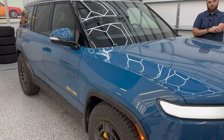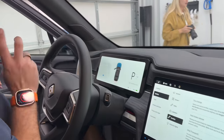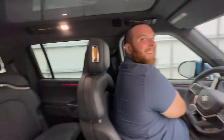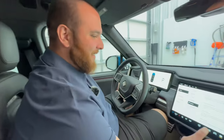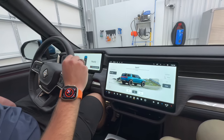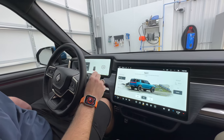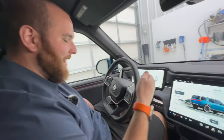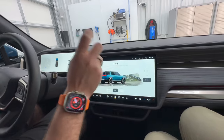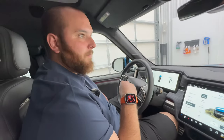Before washing, make sure all your windows are up — that back window was cracked. We're going to put it in neutral and raise it to the highest suspension setting, which is really important for cleaning wheel wells. You'll come into the vehicle, put it in neutral — hold the shifter to the middle setting just like a Tesla — and go into off-road mode to reach the highest height. You want to be off the brakes and in neutral so the suspension can move and we're not pushing against the parking brake. That little indicator stops flashing when you've reached the target height.